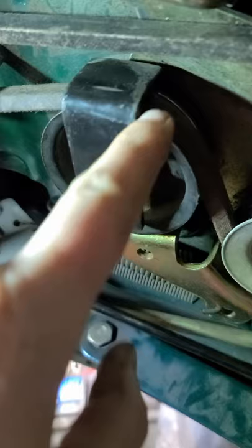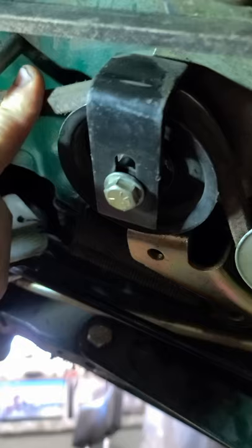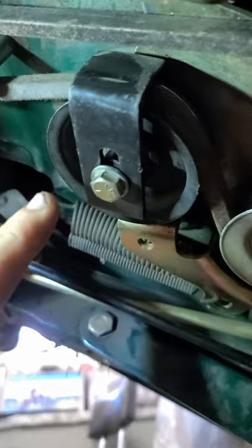So it would come off right here. What I did is I just grabbed a piece of angle iron — it already had holes — and I put it in there as a belt keeper. I've had to do this multiple times on different MTD lawn tractors, so if you run across this issue and have a belt that keeps coming off, make your own belt keeper. It will fix the problem once and for all. Thanks for watching.